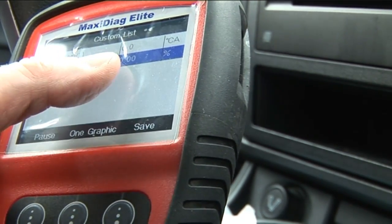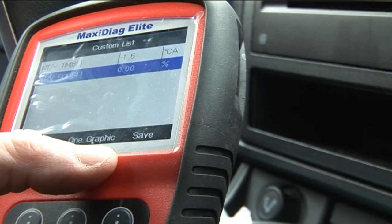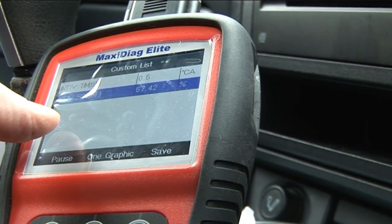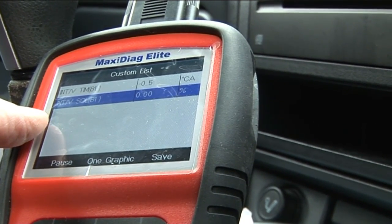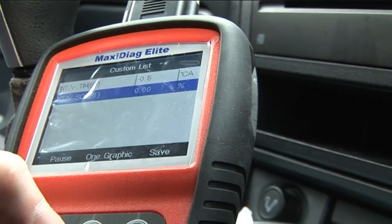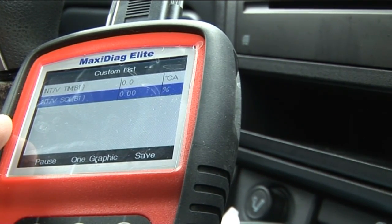In the timing, as you can see, it's actually trying to do something, so we have a problem with valve timing — more than likely an open circuit on the solenoid. I'm just going to rev up the engine now and you should see this percentage — the on-time of the intake valve solenoid — change. As you can see it does change, but the intake valve timing up here is pretty much static. So we have a problem. I'm going to go under the bonnet and have a look at the voltages on the variable valve timing solenoid.